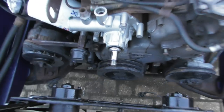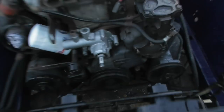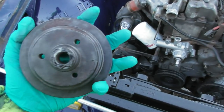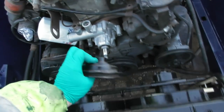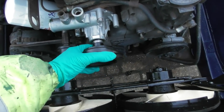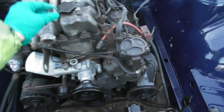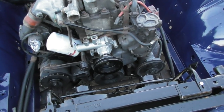I started with sandpaper going around and around but it was hardly touching it. It started getting dark and I thought, stuff this - I got my die grinder and rattled it around the inside to open it up. That's worked really nicely because it's quite an easy fit until you get to the end and then it's just a nice push fit. I don't really understand why the tolerances were so close because it's held by a Woodruff key, a massive nut, and it's sitting on a shoulder, so there's absolutely no play. When it's bolted up it will be fine.